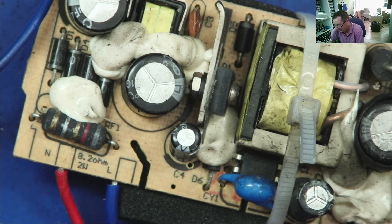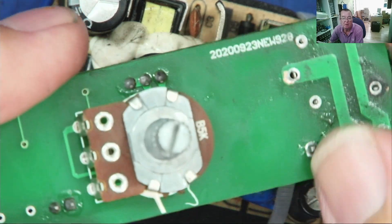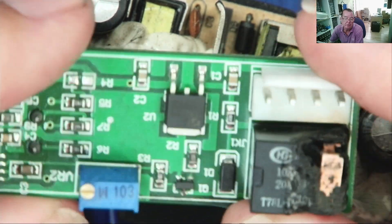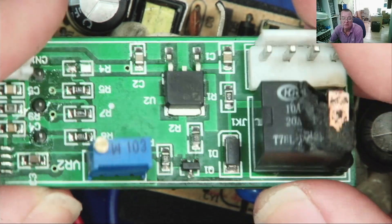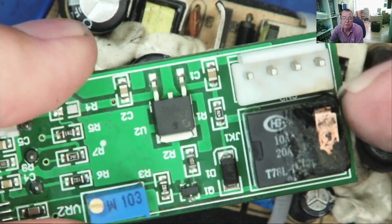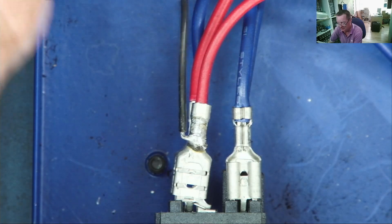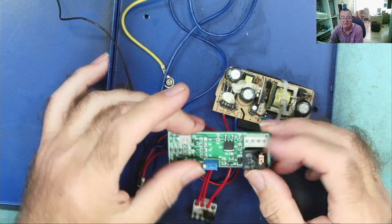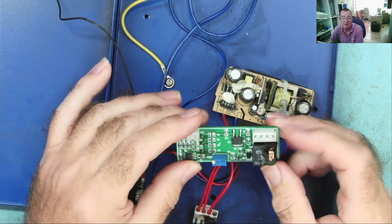There's nothing in the problems I found that would explain the fuse blowing. This control board only has the 12 volt supply on it and it switches the live or neutral to the heating element. The heating element works - we've tried that. So there's no neutral here, this is the live, the neutral returns directly back to the power switch. This is the return from the heater. Why is this blowing fuses? I don't really know. Handy Andy went to the electronic shop in Las Palmas and they don't have these relays.